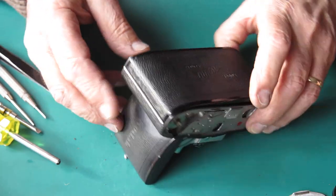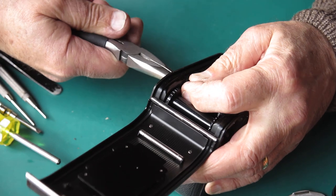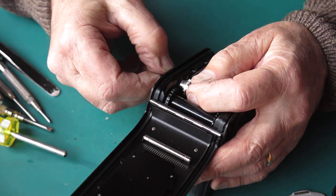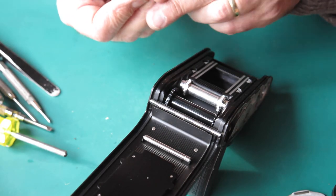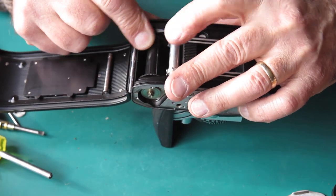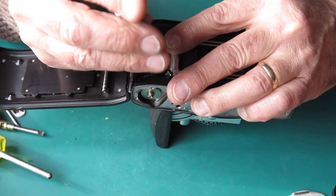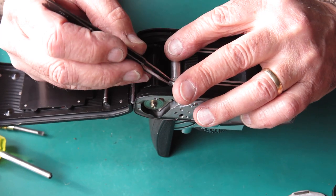The rewind button can come off next — I've got pliers that'll do that. That was tight. I don't put the springs through the ultrasonic cleaner; some of them you'd be asking for trouble — they'd fall out of the holes in the basket, get caught on things and get damaged.